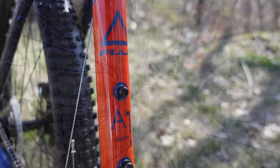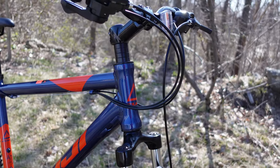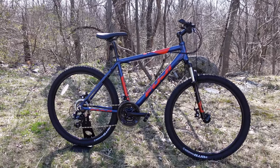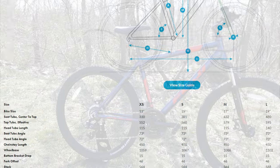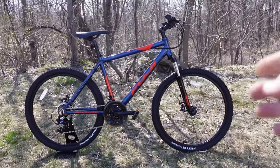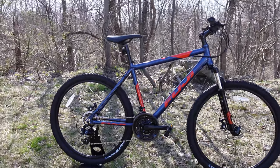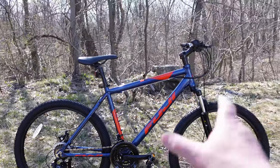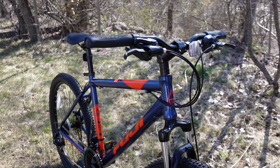Feature-wise, this has an A1 SL aluminum frame from Fuji, meaning straight stock tubing with an inch-and-an-eighth threadless headset. The frame geometry is more in that dual sport hybrid setup. In a size 19-inch frame, it has a 73-degree head tube angle, a 73-degree seat tube angle, and a chainstay length of 450mm with a reach of only 415mm. In plain terms, the front end is reasonably steep for good pedaling, the chainstay is a bit longer, and the reach is shorter — making it a comfortable all-around bike but not set up for the most aggressive terrain.